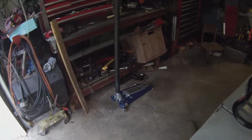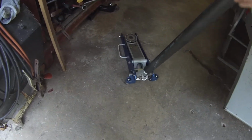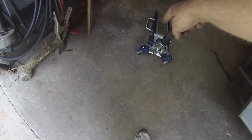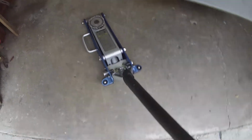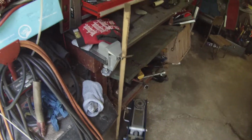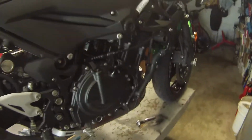That's a little better. My floor jack was dragging the back wheel, and the casters were not rotating. So I sat down for half an hour and lubricated all the bearings that the casters pivot on, and the axles and all the pivots, and that back wheel was not rolling at all. I put some oil on it, and look. Pieces of equipment, tools, motorcycles, cars don't wear out. They are neglected to death. So don't neglect your motorcycle.